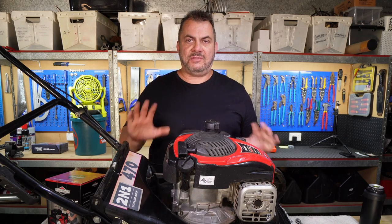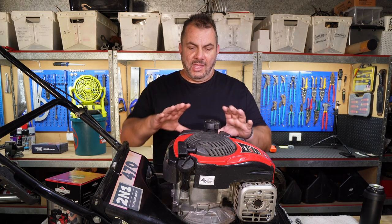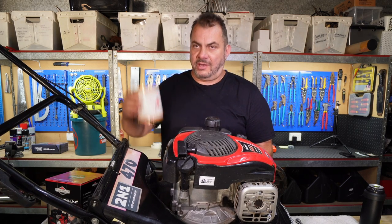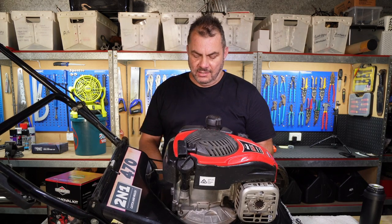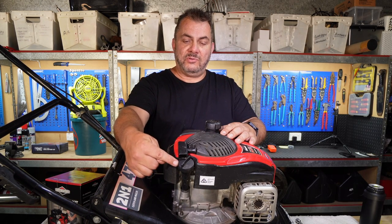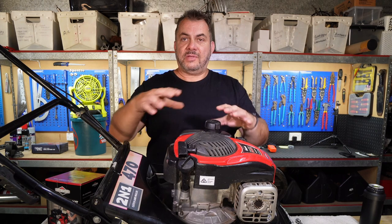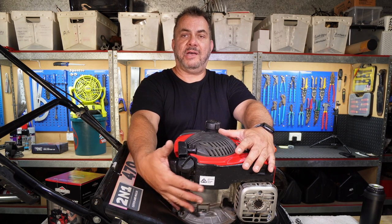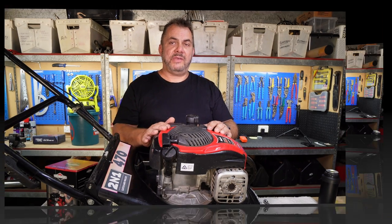This is just a basic service that anyone can do at home. As you can see here I have propped the lawnmower up on a paint can. That way it sits up on an angle facing towards the oil filler port which is located right here, so most of the oil will be gathering up in this part of the engine. When we're extracting the old oil we'll get most of it out.